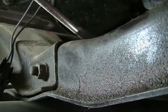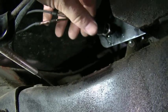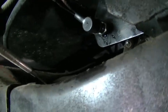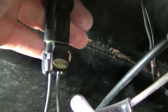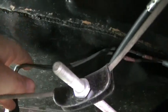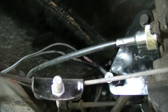One thing else I wanted to show you. One of the main reasons I got this switch is I knew it would work, or at least I had a pretty good idea that it would work. Not to mention it's for a motorcycle, so it's capable of being out in the elements. So what you saw originally was just a couple of bullet connectors. Well, I've spliced in a GM weather pack connector just to keep things a little bit more watertight. I used some heat shrinkable butt connectors on both ends. Everything's wired up. I need to clean up the wiring a little bit, but nonetheless, it's wired up. So like I said, let's get the cameras set up and we'll go see if the lights work.